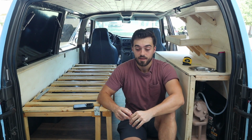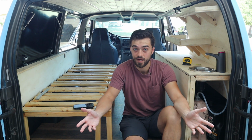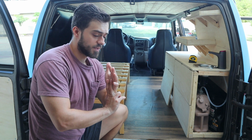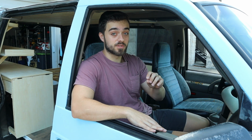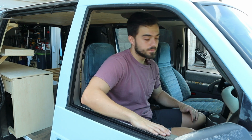The biggest issue with both of those AC setups is that it would take a lot of energy. I would need a heavy duty battery system to even power it for a night, or I'd have to be plugged into shore power, which means the only way I can have AC is if I'm on some sort of campground. I mean, I could buy a generator and lug it around, but they are loud, they take up a lot of space, and not really what I'm going for. So then I thought, what is an idea that would take a whole lot less electricity? I could get a cooler, cut 2 holes on top, put ice in it, and blow a fan on it. A lot of people have done it, and it works very temporarily because the ice melts pretty quickly because you're blowing hot air directly on ice. It's not efficient, won't last all night.